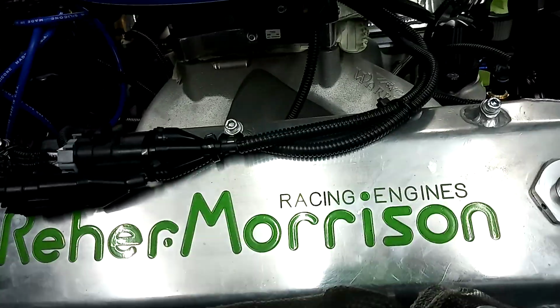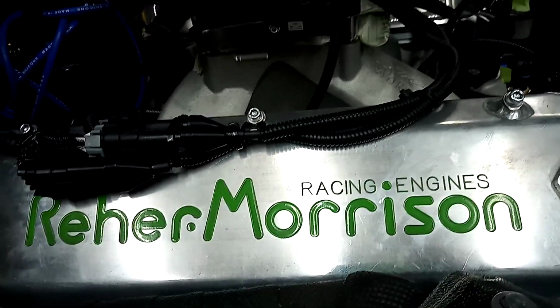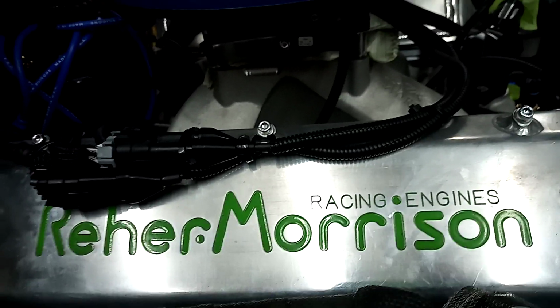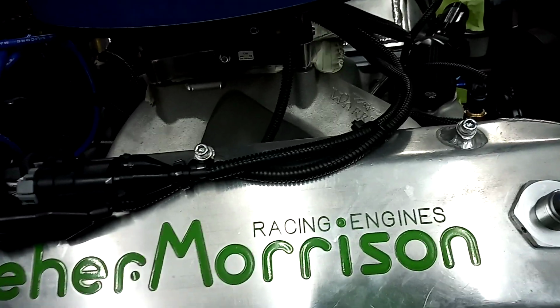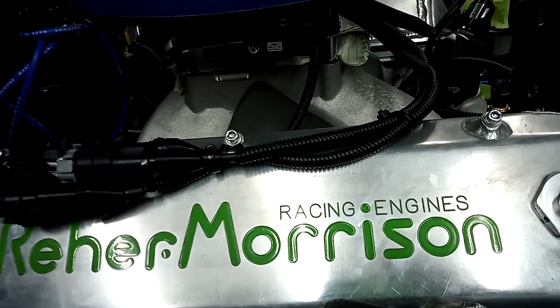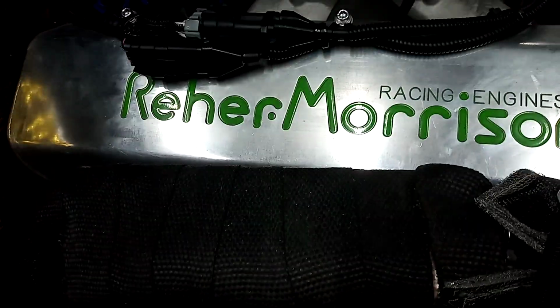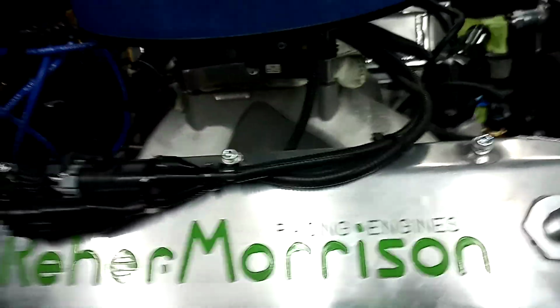Fixed the little issue with the drain pan. The oil pan drain plug was seeping. When they put it in the pan at Melodon, somebody cranked it down tight and smashed the copper washer, so we replaced it. And I kind of like it because it's magnetic, the plug, so when you pull it out you can let go of it and it'll just stick to the pan. You don't worry about falling in your oil. But nope, she got 8 quarts in the pan and 1 in the filter makes 9. So we should be good to go.